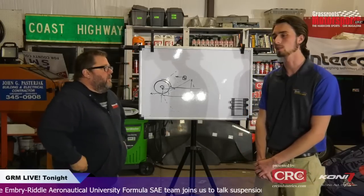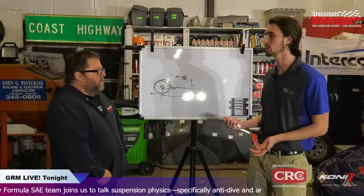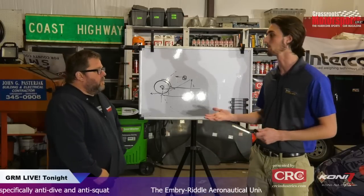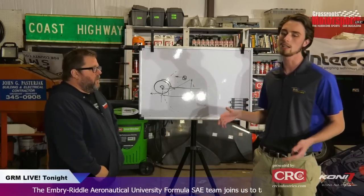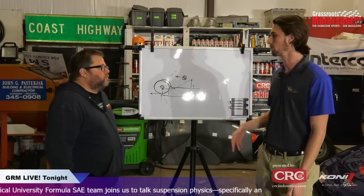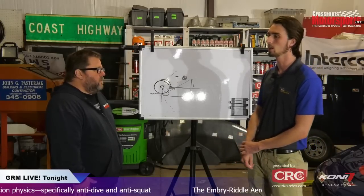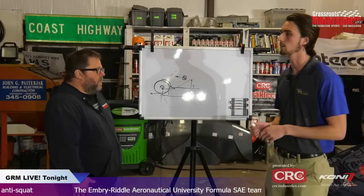So essentially that would really be the only negative effect per se, it just comes down to that, because it's almost the same thing as having a rigid bar for a spring. It just makes it a little bit harder to drive. Another negative effect is dampers. Usually your spring travels, the damper travels as well, and you're able to get damping, and usually you want that damping through your whole travel. So you do lose the ability to tune damping if you had 100% anti-squat. That would be another disadvantage. Those would really be the only two main ones I could think of. And then you also have the added problem with an independent suspension of potential toe gain if you don't set up your toe links and tie rods correctly.